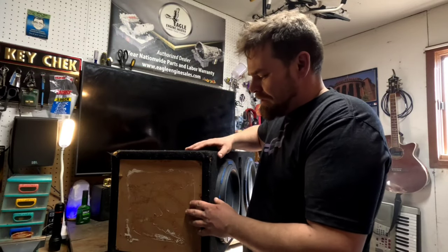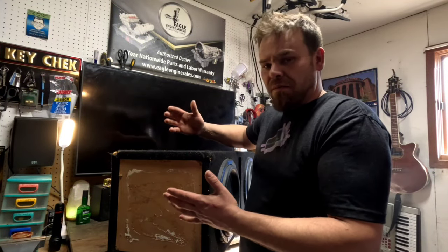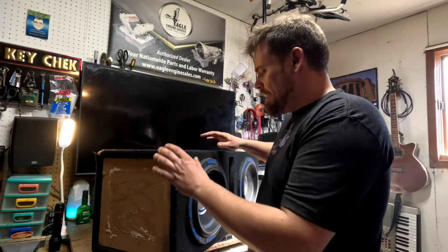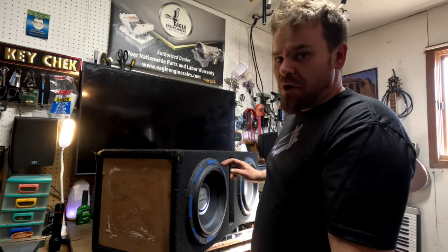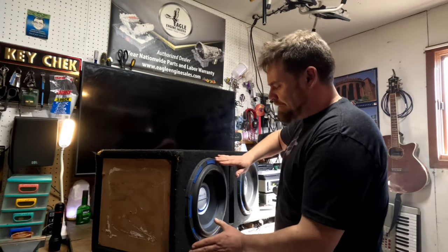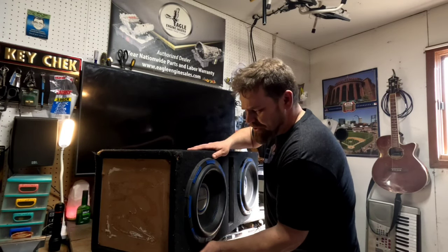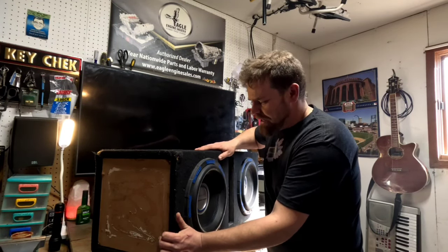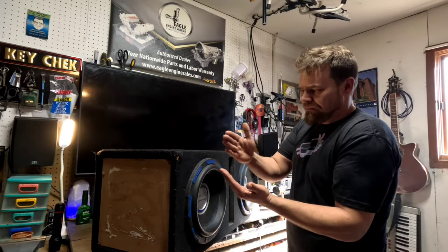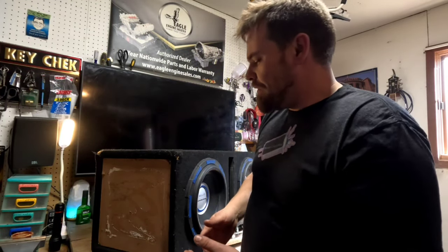The clip showed it wouldn't really make any noise at a lower volume, but when you turned it up you could hear a really really loud rattling sound. Usually what I do first is hope it's not the speaker, and then try pushing against the front of the speaker — the baffle that actually holds the speaker in — because this whole piece can become loose and wobble back and forth, making a lot of noise.